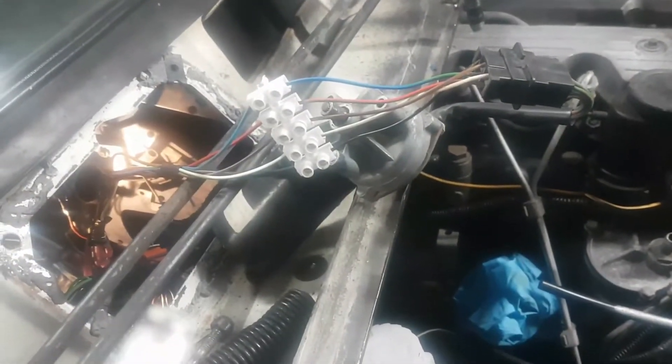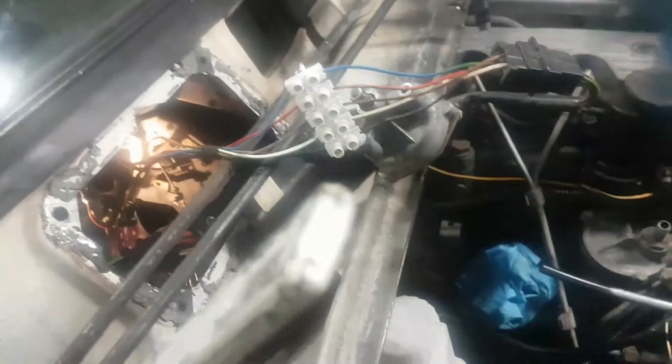So I put another motor on — this is the one I got from my spares man. I didn't actually fit it because it had the same connector as the one already on the car. It's just a right-hand drive motor and it only works in high speed. So this is the other one — the one I bought last week. Fiddling around with the spare control, I get slow speed. There we are — slow speed! And fast speed! But no park. If I put it down to the intermittent position it just runs continuously, and if I turn it back to off, no park — it just stops.